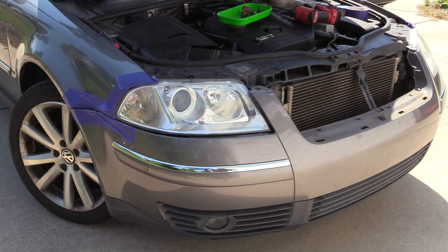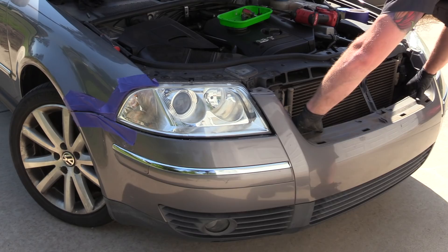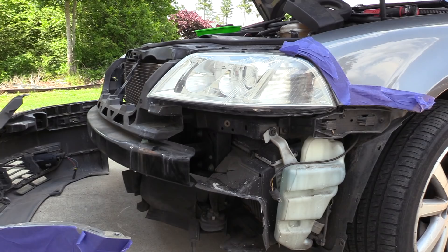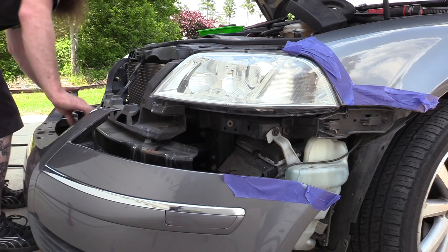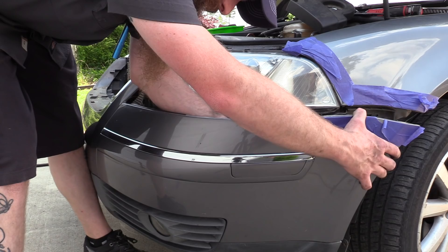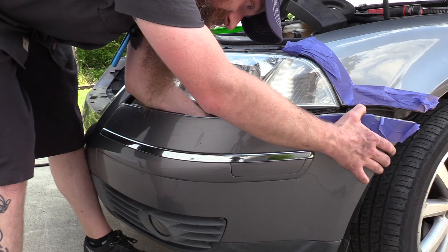What I usually do is put the bumper cover back on and go do the other side. Now we have everything disconnected. We can grab the bumper cover by the center and slide it forward and away from the car. Next, we're going to set the bumper cover close to the car so we can plug all of our lights back in. I hold it on the car with my leg and then plug in the marker lights as well as the fog lights. Typically, I do the fog lights first, then get the marker light plugged in, set the bumper cover back, and do the lights on the other side.